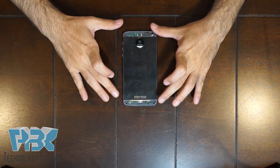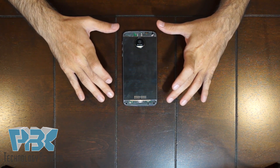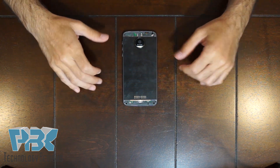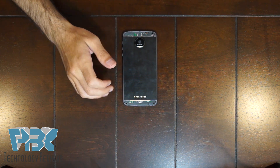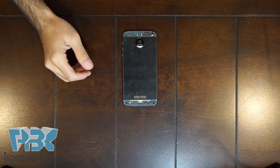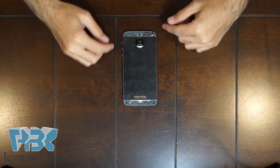There's two glass panels on the back of the phone which you need to remove. Keep in mind those are glass, so there's a strong chance you can break or crack them when you're taking them off, so be careful. Once you remove those two glass panels, there's gonna be four T4 screws on the bottom of the phone and two on the top.